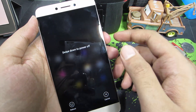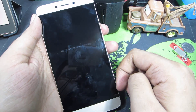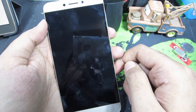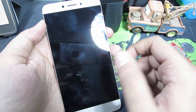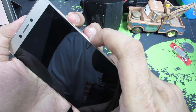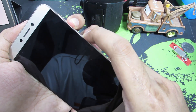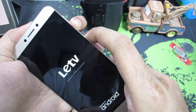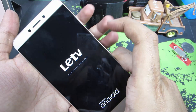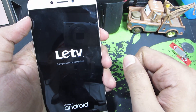For that, you need to firstly turn off the device. Once it is turned off, you need to press volume down and power button both at the same time to enter factory mode. You can start with volume down and then press the power button — make sure your device is turned off. Press and hold them until you see the logo or you feel a small vibration. Then release the keys and wait until it boots into factory mode.